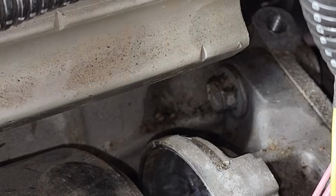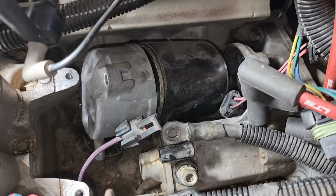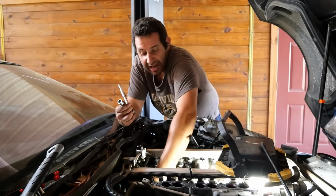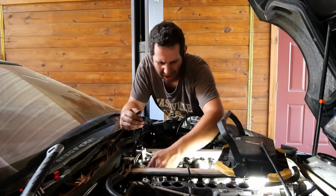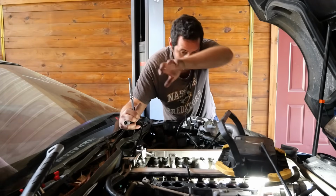So yeah, the trick here was to basically dismantle the starter on the bracket, get it out of the way so you can get to this bolt. Let me show you this. This is an extractor right here, the open-ended wrench. Slipped this bolt here. I said during the plenum removal, this is probably the hardest part of the job. It has progressively gotten harder and harder until we got to the starter.